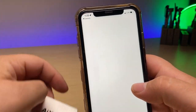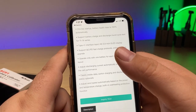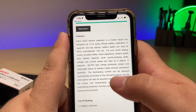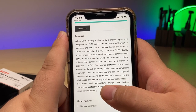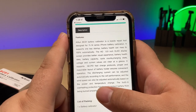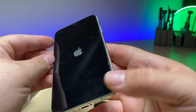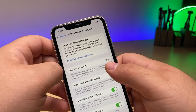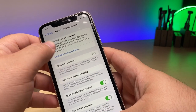Let's take a look at the product manual. You can see here that it's designed to raise your battery health to 100% automatically. You can pause the video to read the actual description, but it's basically designed to help you recalibrate the batteries once you've replaced the actual cell itself. To show you how this works today, I've got an iPhone 11 here that is in need of a new battery. When we go into the battery health, it shows us at 73% — definitely something we need to service here.